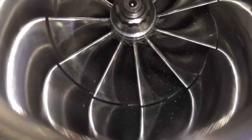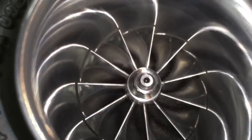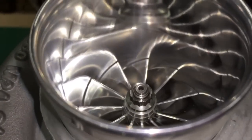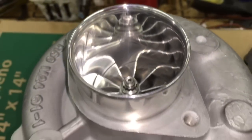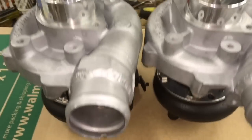To fix it, since I was converting these over anyway, I went ahead and machined the compressor housings for inlets so this customer could run intakes on his compressor housings without having the bolt-on flange.